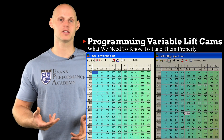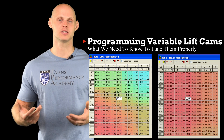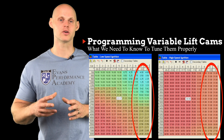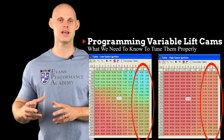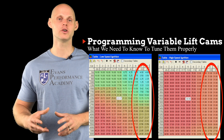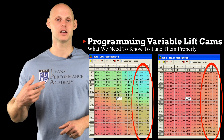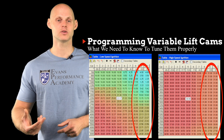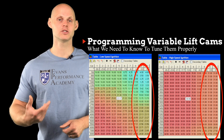On the same side of things, we have a low cam ignition timing table and a high cam ignition timing table. If we look at the values in the table here at something like wide open throttle, we can see the values on the low cam are about 23 to 24 degrees. Looking at the same wide open throttle area on our high cam, we can see they're between 28 to 31 degrees. That's a large difference in ignition timing, and that's because that intake valve closing point is changed on that high cam, which is going to change our dynamic compression to lower it. And therefore, we're going to be able to increase our ignition timing.